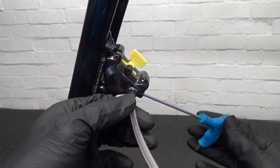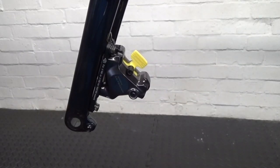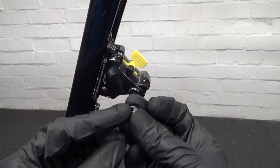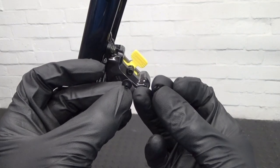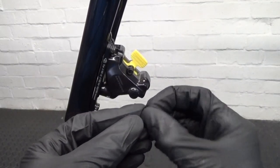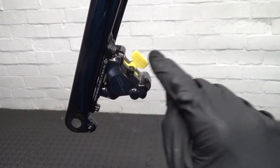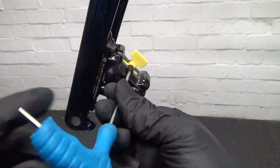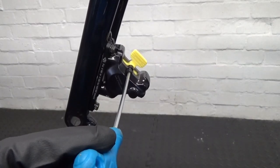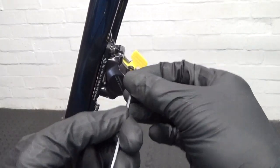Once you've completed the bleed, you can just lock off your 3mm hex there — just shut that up and then remove your hose off of there. So you can put your rubber covers back over — one of them's got a bigger hole in it and one's got a small point sticking out. The larger one goes over the actual bleed nipple, and this one with the smaller hole goes over your hex head. So we can go ahead and put the pads in. Slide the pads in and put your pin in.